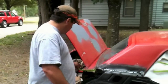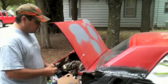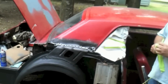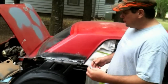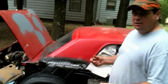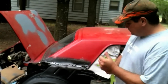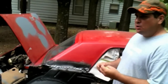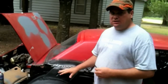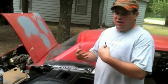Now we've got our flanges here that we kept bare metal, where we're going to be either welding or putting adhesives. So we're going to go ahead and peel this off and start putting some adhesive on here. When you get ready to do this part of it, be sure that you're ready to get it on, get the screws in and get it all set. Because this adhesive has a certain amount of time to get it on there. You can come back and do the welding later as long as it's set right. But with the adhesives, you've only got a fixed amount of time — you've probably got over an hour to work with it. When we get that panel on, you can't take it back off. You can slide it around, but you don't want that adhesive to pull away from each other or it'll create a lot of bubbles and a loss of adhesion.